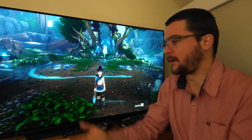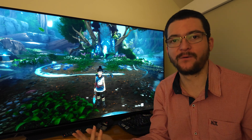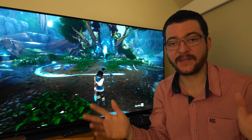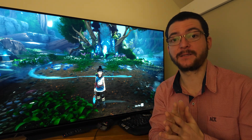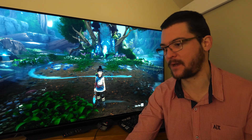You could use dynamic tone mapping, raise the EOTF tracking, and then use black frame insertion. Native HDR with dynamic tone mapping and OLED Motion Pro can work, and it might sometimes have a fantastic result. But SDR makes more sense because the range of SDR is a lot smaller, so you can raise the entire thing.